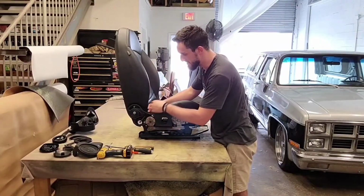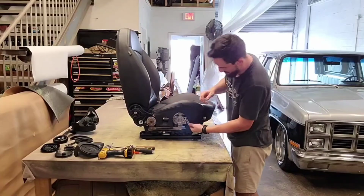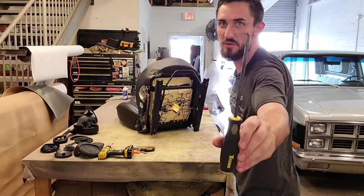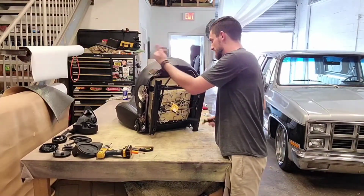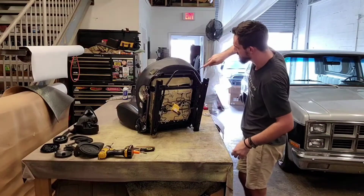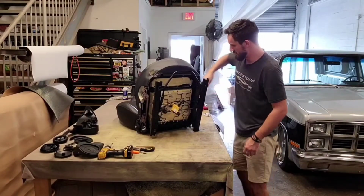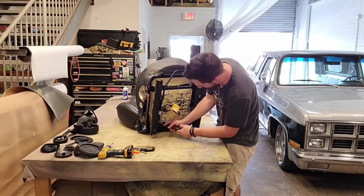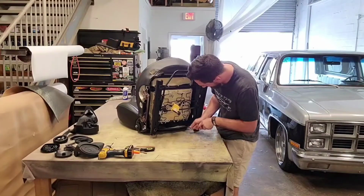So you've got some felt here. That's just for the rub area. This was already disconnected for some reason. But those are just some C-clips. And what you do is you take a hooked awl. So you take one of these here, and you go up underneath, and you just pull on it. Boom. Yeah, that one's part too. You just want to pry down. Some of them have an extra lip that might be a little harder to pull off, so you want to push down a little further. But you just put that in there and pull. And that one, boom. This one's very sharp, so I can get in there and wedge it apart. But with it being very sharp, you want to make sure that you don't damage things. So I'm taking off this back panel here.